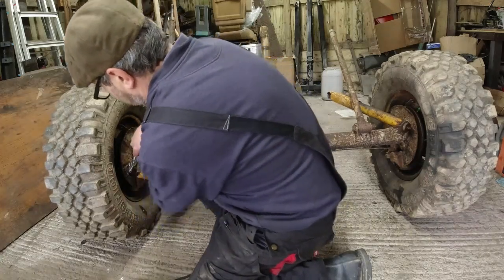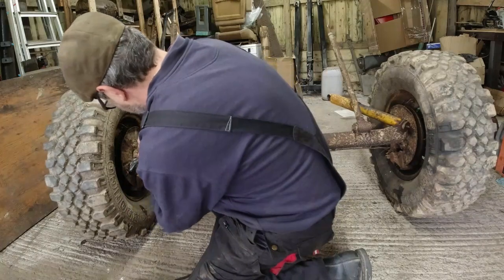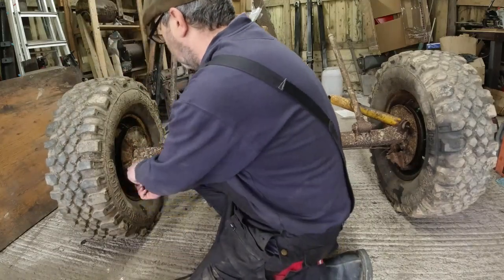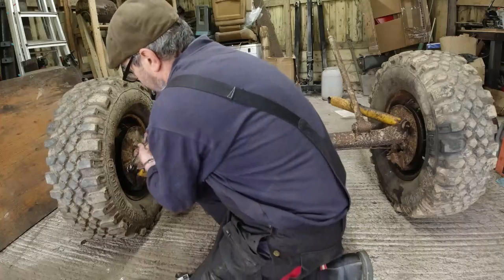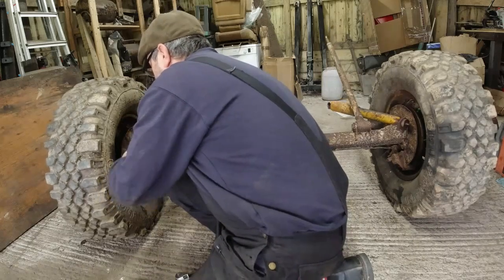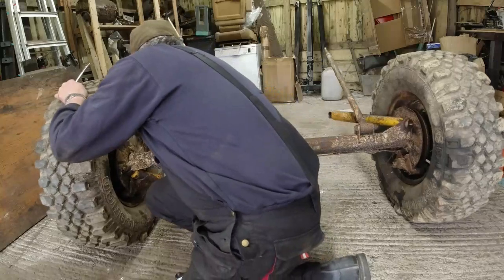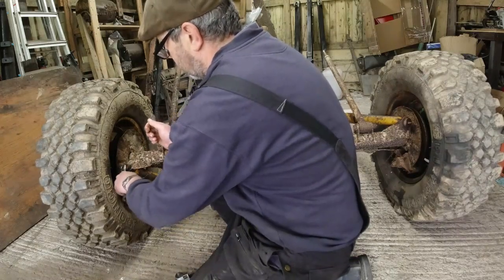Do this now before the wheels come off, because then ultimately when I get the wheels off, this thing will be standing on axle stands, and it's going to be, come on you bastard, sort of fairly stable. Right, now it feels like I can actually get hold of the tube now. So I'm just holding the damper tube itself. In fact, there we go. Unlike with other cars I've messed around with, there's no spring, there's no weight on this damper. It's literally just the bottom there.